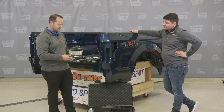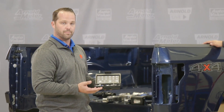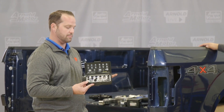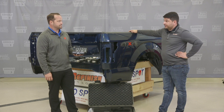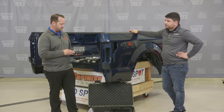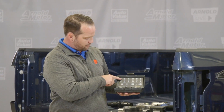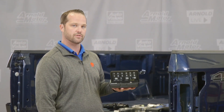On the PR5 the dies screw in and out so they're fast and easy to change. Your repair procedures for Ford or Tesla will reference the ProSpot part number to tell you exactly which die to use. For example, a Ford cab corner procedure will literally tell you to use ProSpot PRR-41 and 40 for solid rivets, or use 401 and 399 for your self-piercing rivet. That makes it really easy for any technician, even with a new tool. Very repeatable results with the PR5.